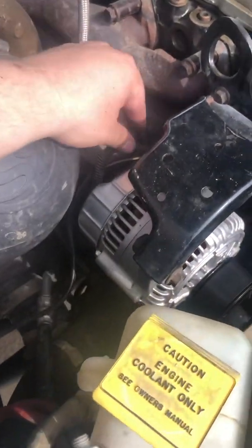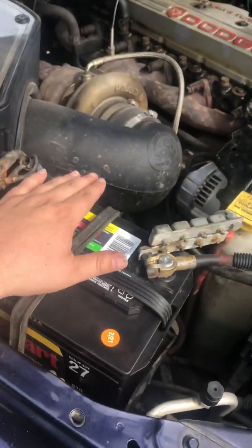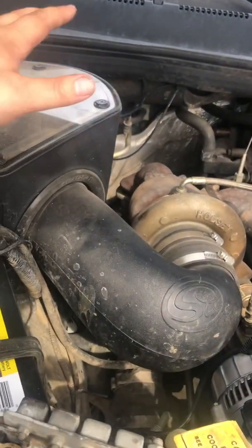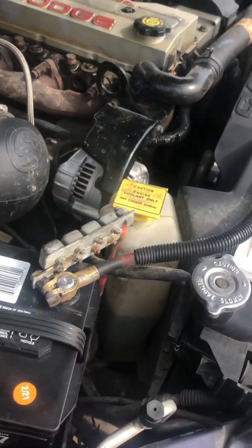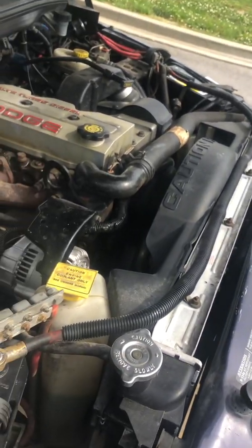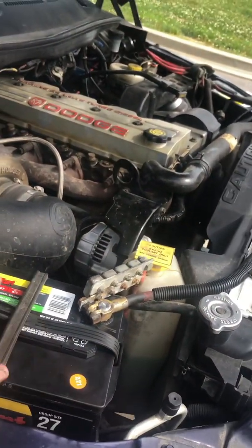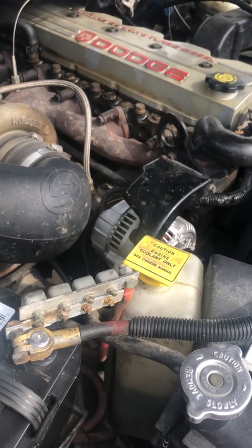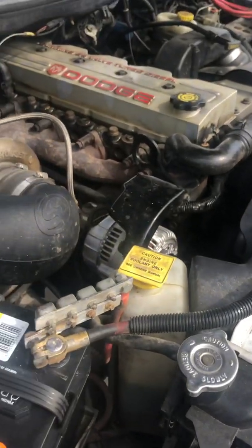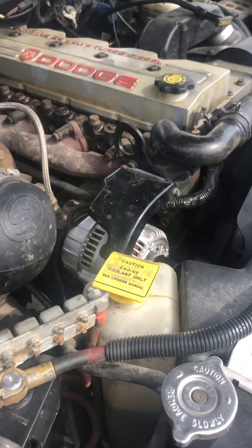There is a two-wire plug that clips into the back of the alternator, along with one single eyelet wire — the power wire that actually starts charging the battery. The PCM on the firewall is what tells the alternator how much charge it needs. This truck was charging at 16.5 volts — that will kill your batteries, and it already did. It'll completely obliterate your batteries and can also screw up your blower motor, lights, and other electronics. When it was overcharging, I was pretty sure it was a ground problem — that the PCM was reading a bad ground and trying to push excess voltage through.